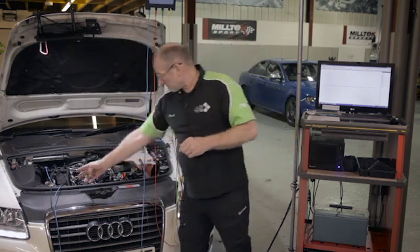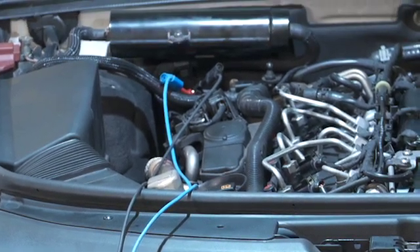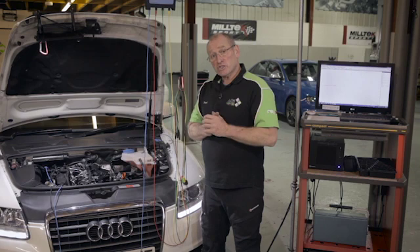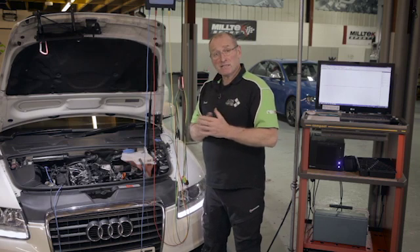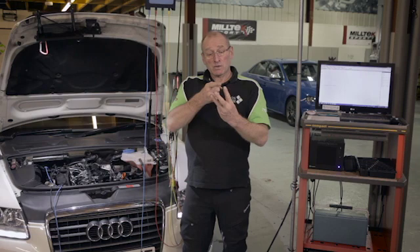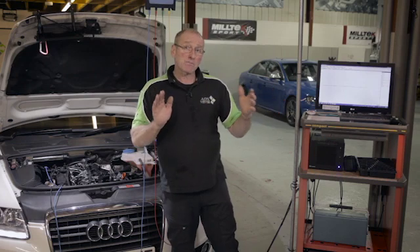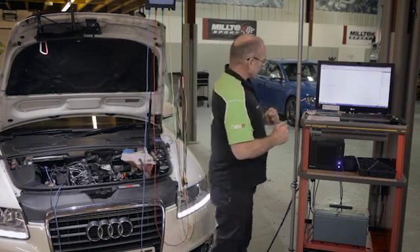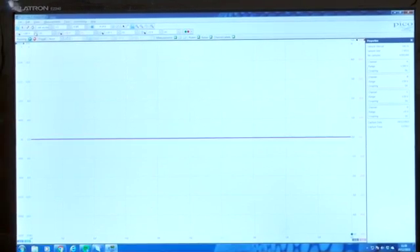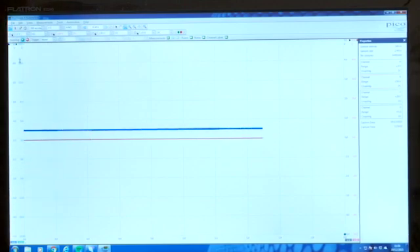We have a potential difference voltage on the blue cable — it's a floating measurement. I'll experiment with filtration to see if there are any benefits. Sample rate: four megasamples — pretty much my standard. Time base: the suggested free time base is 1 millisecond, 100 milliseconds, and 5 seconds per division — giving us 50 seconds for a profile. Free run, no filtering, no triggering. I would much rather use time than trigger. 0 to 5 volts sets the range.